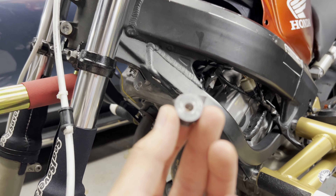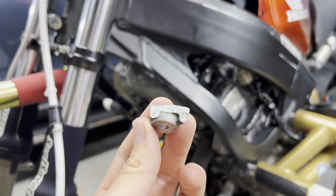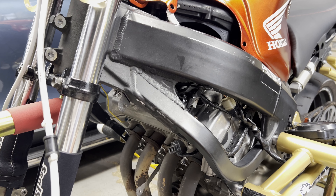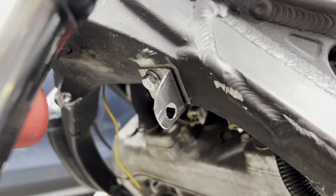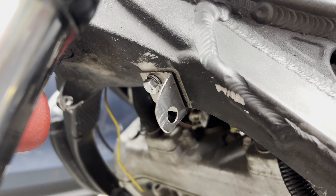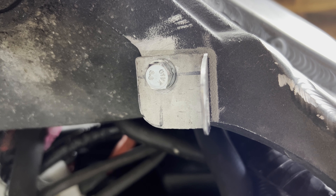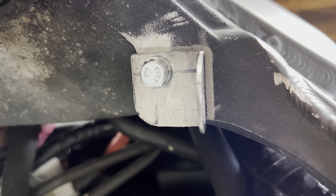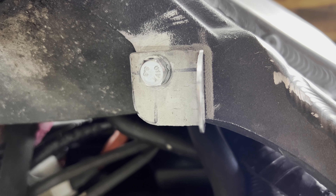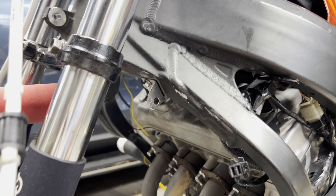There's not a lot of surface area there. I could have tried to get somebody to weld it quickly but I didn't want it to break again - whatever keeps me on the bike the most is the solution I want. So what I ended up doing was making my own bracket. I took a tube square of 1/16 inch steel, cut myself a right angle, drilled into the frame - that's an M6 1.0 bolt. I drilled a hole about a half inch into the frame and tapped it. I've got a flat washer and one of those star lock washers plus red Loctite. This thing is solid, it ain't going anywhere.